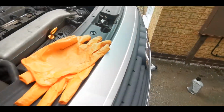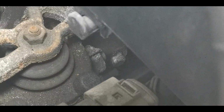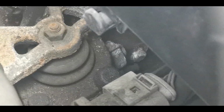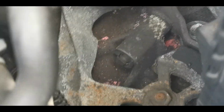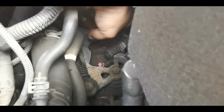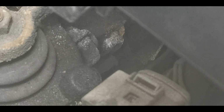So then in the engine bay, we're going to need to get to, now it's easier to take the battery and everything out, but this fella right here, you can see, that needs to be pushed in once the assembly is in the neutral position, which basically, to get it there, the whole thing just needs to push down ever so slightly, and once it's ever so slightly down, you'll be able to push that pin there into place, and that'll lock the gearbox off.